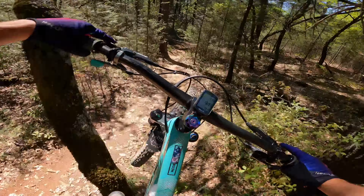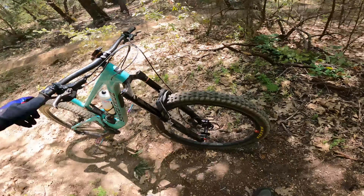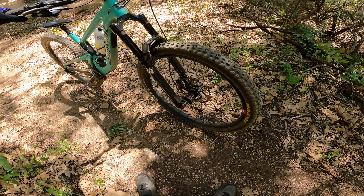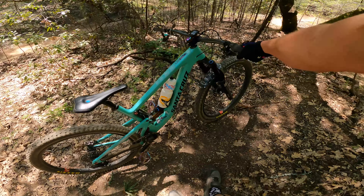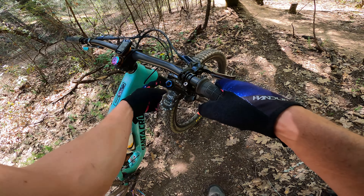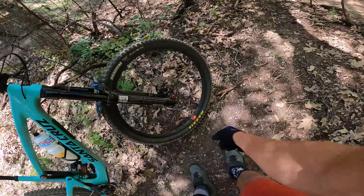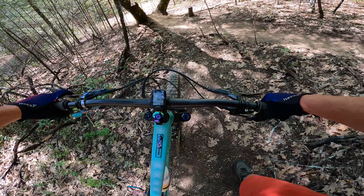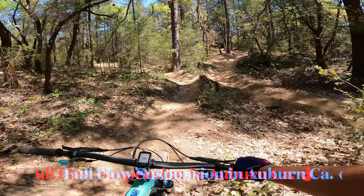Little drop here — tried to bottom that out to see where it is. Nice, that's actually pretty good. Still below the Debonair and the max travel is up here, so I've got a good three-quarters of an inch left, and I tried to push that into the ground pretty hard. So I think 61 psi is my pressure right now — one click of high speed and eight clicks of low speed, that's kind of my magic setting. There are 18 clicks of rebound and I'm at 10, which is one faster than medium. It's working well — I'm actually more surprised today than I was yesterday. Thanks Full Flow, did me good.